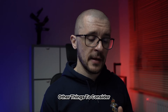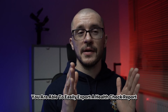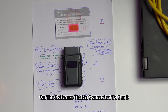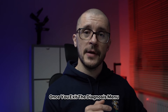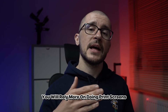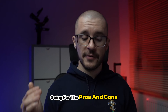Other glitches noticed in the system: on the D7 you are able to easily export a health check report after a scan. On the software connected to the A30M, it will automatically generate a report once you exit the diagnosis menu, so you don't have that much control over what you're exporting. You will rely more on doing print screens and saving information that way. A small thing, but something they can still improve going forward.